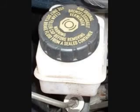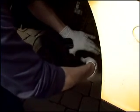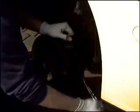Lift the bonnet and remove the brake fluid reservoir cap and place some tissue around the outside in case any brake fluid is lost when you push the piston back on the brake caliper. Remove the two guide pins from the back of the caliper. These hold the brake caliper onto the carrier. In most cases you can simply move the caliper straight off the disc once these are removed.